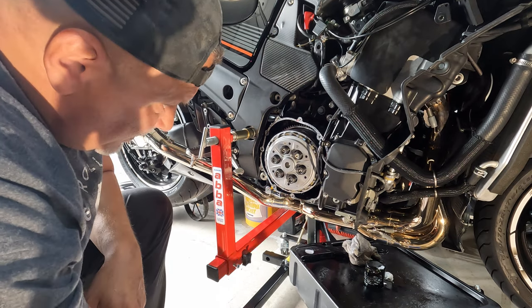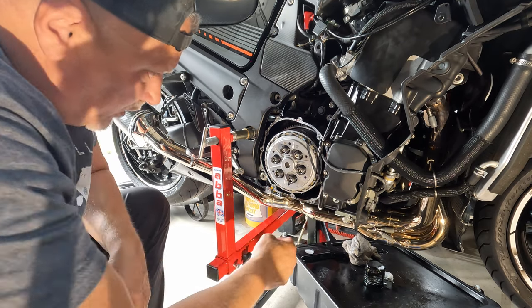When putting the clutch cover back on, do not forget to put semi-permanent Loctite to seal those threads - it's threaded all the way into the case and is under pressure, so you will get oil if you forget. Now pull on the clutch cover - just slightly tug and it pulls right off. Check the gasket - it looks good and is reusable. Now we move into the clutch spring bolts, spring holders, and springs, replacing them with the Brock modification and removing the slipper clutch.